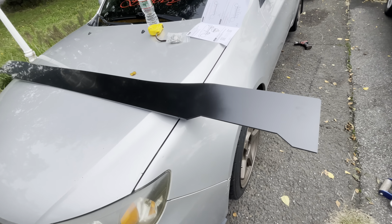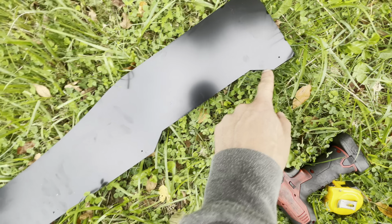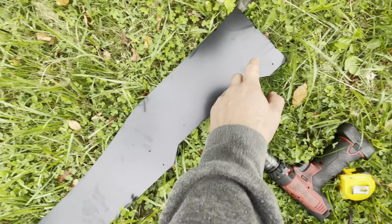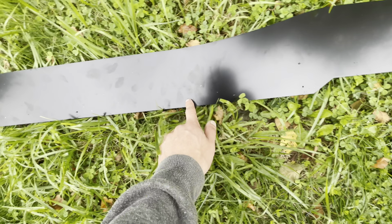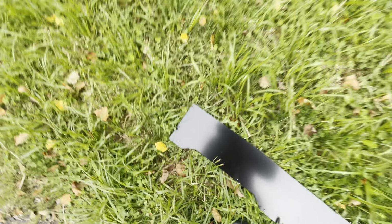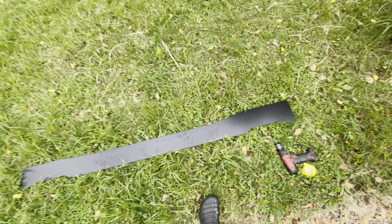It's not much. I got all my holes drilled. I went a little bit different because I want one in the corner on each side, and I also want one right after where the lift post arms would go. So I kind of just spaced them out by eyeball. I didn't really go off their measurements, but I put one here, one here, and so on, and then there's one at the end. They give you 16 screws, so it's going to be 8 holes on each side skirt.